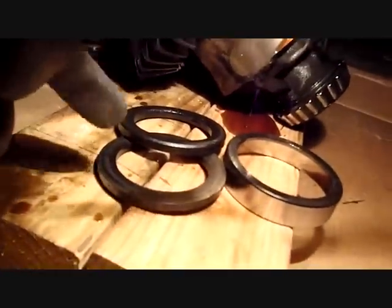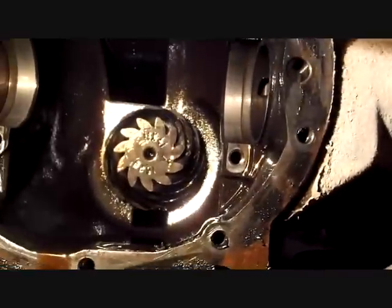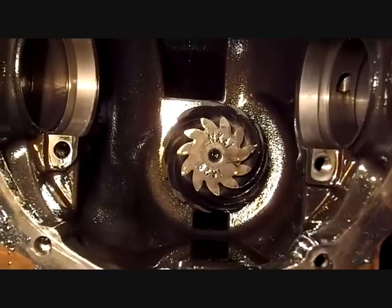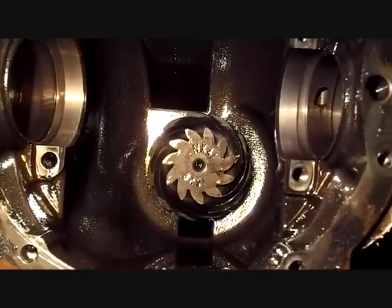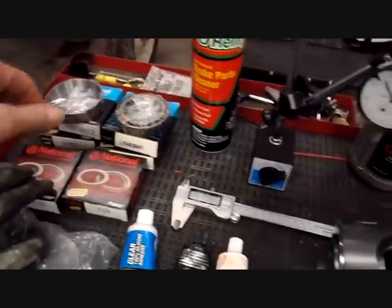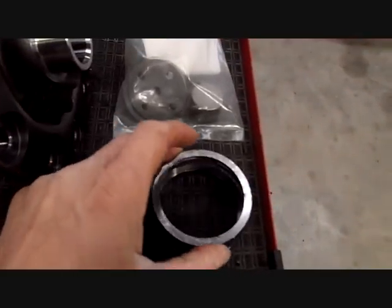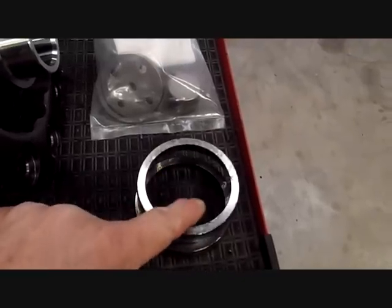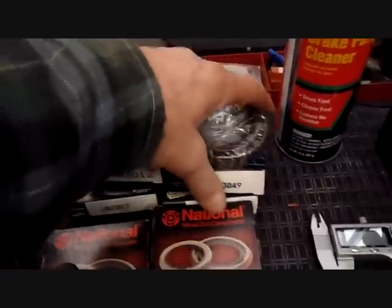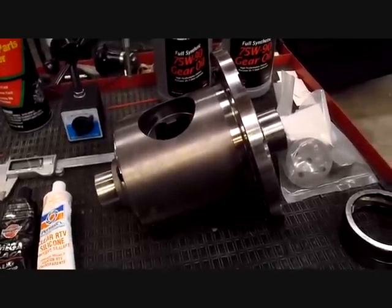The two shims fell out, but since I marked them I know where they go. I'm going to inspect that pinion gear really well, rotate it and check the bearings to see if they feel alright - other than that I'm just leaving it. I've now verified it is definitely an 8.625 diff - I checked because the bearing races are the larger ones and on the race the part number corresponds with the part numbers here. I'm ready to press these bearings on and exchange the ring gear and start reassembling.